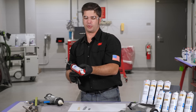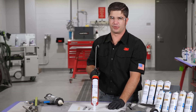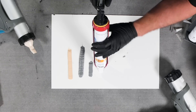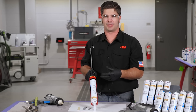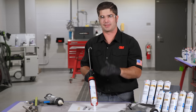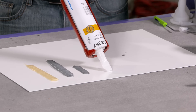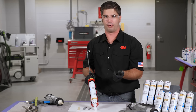Here's why this works so well when you do that: it becomes your pressure point. You leave this right on the surface — you don't have to touch anything. So now you're guiding it along the surface and forcing the material into the surface. You'll hear me talk about this a lot with seam sealers — creating a tight seal with the seam sealer to the surface. It's important, depending on what type of seam sealer you're using and what chemistry, to understand how we're going to get that tight seal for adhesion and corrosion resistance.